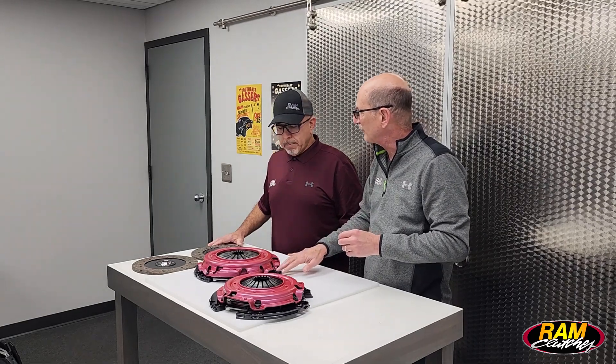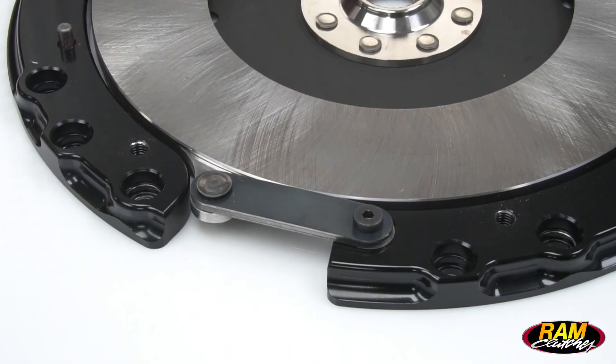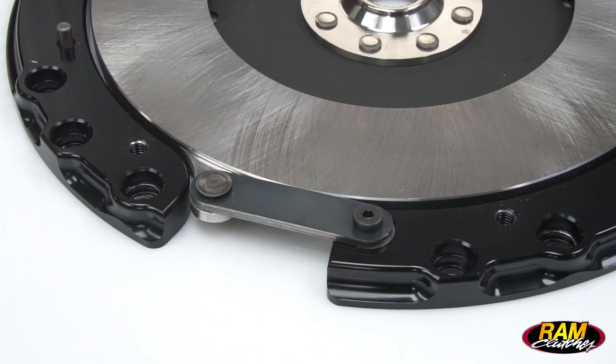We're still using a strap-driven floater plate, so it's going to be nice and quiet — no problem with noise. It's going to mount on most any flat flywheel, whether it be a RAM flywheel or a factory unit. Now, something we need to point out is that because of the design with the sprung hub top disc, the Concept 10.5 is going to be a little bit taller than maybe some other brands out there in the marketplace.